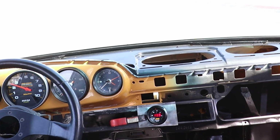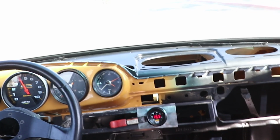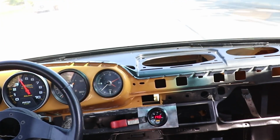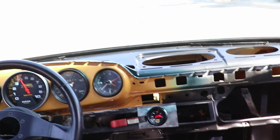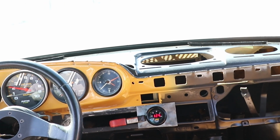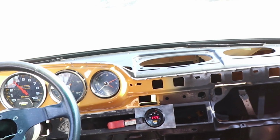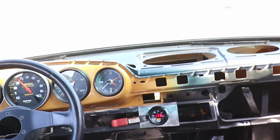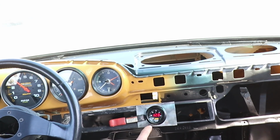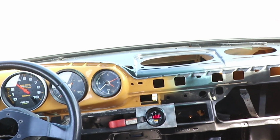So second gear. Okay, full throttle. Big hesitation during the shift because the accelerator pump is not really functioning. Okay, I've turned the accelerator pump in a little bit, about one turn. So let's watch. Still hesitates. So if you watch the meter, when you jab it, it's better, but it still whips over. But it's getting better.